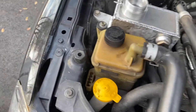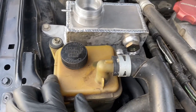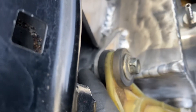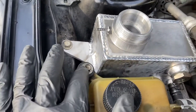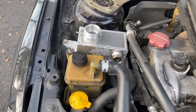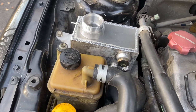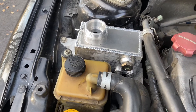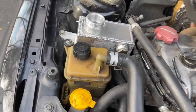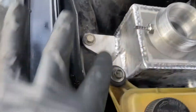Just like that, it's in there. The only thing you'll have to do — or at least that I had to do — I'm not sure if they forgot to thread it or forgot to put an insert in, but I had to get a 10mm nut and put it on the back side of the stock 10mm bolt that holds the power steering reservoir to the coolant tank, because there was nothing there to hold it. So if yours comes like that, just put a nut on the back side to mount your power steering reservoir. The only thing I don't really like is the way it leans — it doesn't affect performance, but it bugs me.